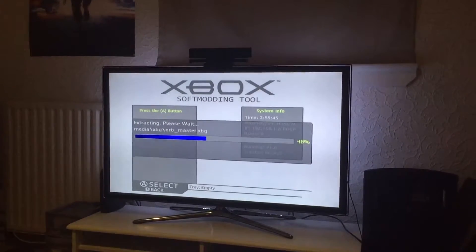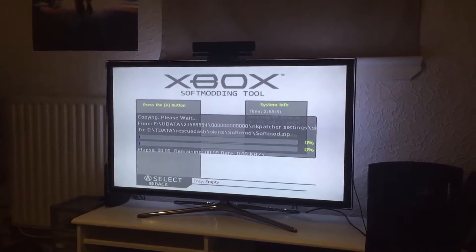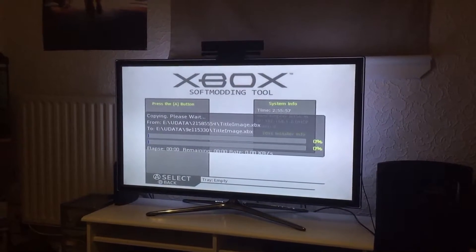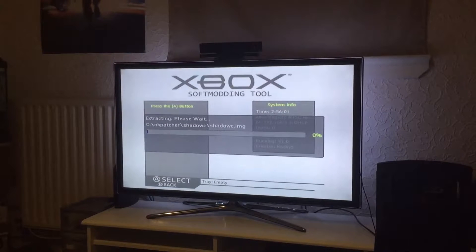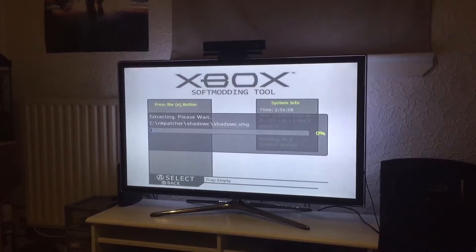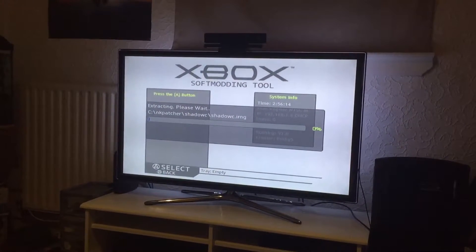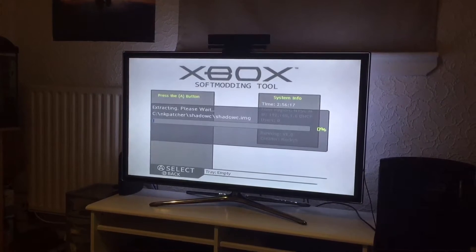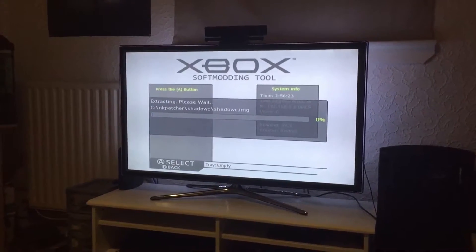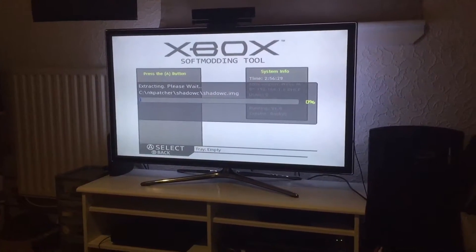It's easier to install. I use my EEPROM Backupper — I know, a daft name — but I use that to do the silent EEPROM backup after the softmod. That produces an EEPROM.bin, an EEPROM.cfg file, and an xboxinfo.txt file which is dated, so if you open it up it'll tell you when you backed up your EEPROM. It has all the Xbox information. Also, there's a kernel file installed to the hard drive, which I use to determine the kernel fonts in the kernel font menu.